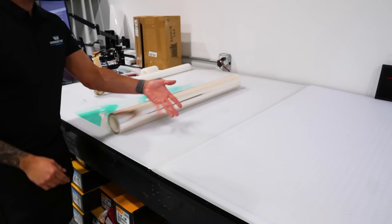Got a little piece of fuzz in the window film here. We're gonna get it out easily. Got our 30 degree blade back in our knife. I'm just gonna pull this back. See, it's right here. Some surgery stuff right here. It's not fully mounted in place. I turned the car off so that the AC isn't blowing anymore. And we're just gonna pull this back right to there where we can see the contamination.